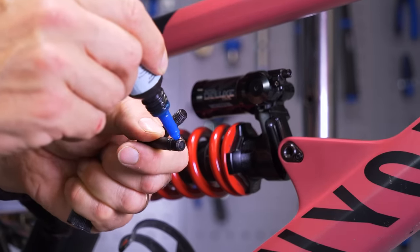With the shock on the bike, there's a slight bit of movement with the spring — this is the preload ring. Adjust this until there's no movement, and then from there you can make your preload adjustment. To emphasize the point, RockShox recommend no more than five full turns of preload with their springs — this may differ between manufacturers, but anything more than five turns means you're on the wrong spring. We now have the shock successfully on the bike and ready to start setting up.